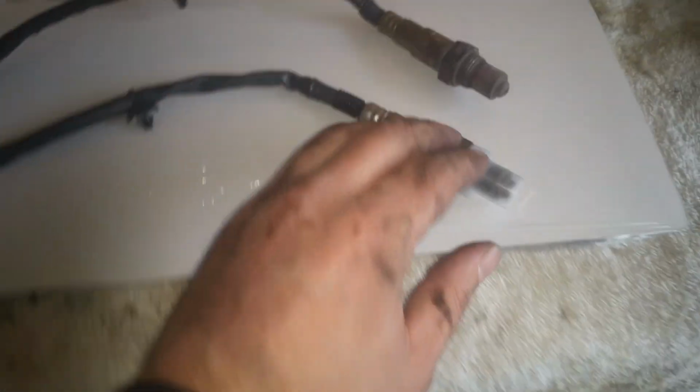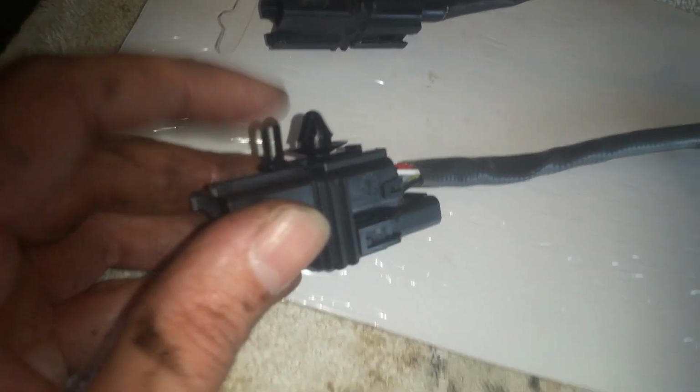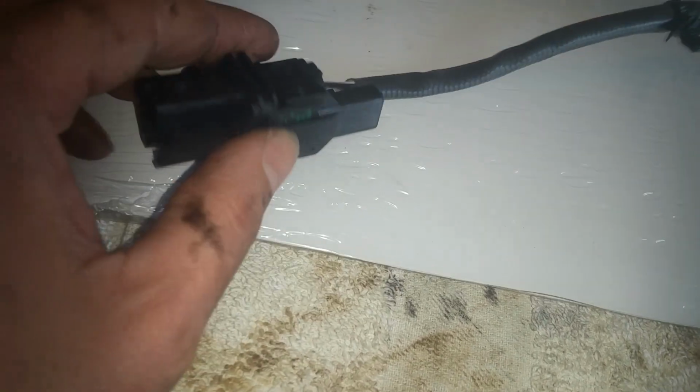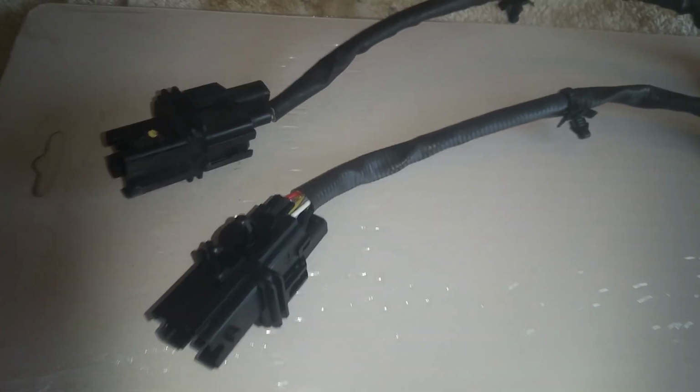Okay, I actually had to go underneath and fish that sensor out because it fell down in there after I pulled my sockets out. Now this replacement has those little tabs that broke, that I was showing you, so it's no problem. It's made right on there. It has the exact connector, so everything is identical. It'll just plug right in, and it already has some anti-seize on it as well.